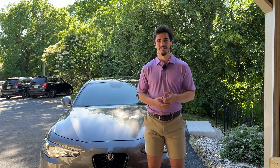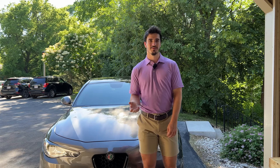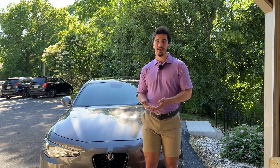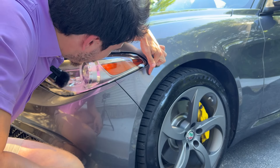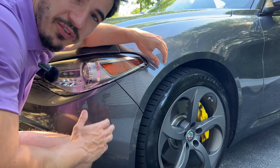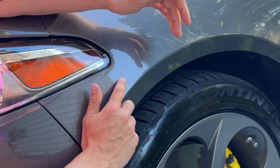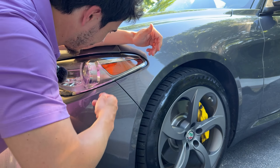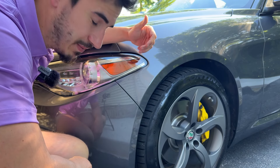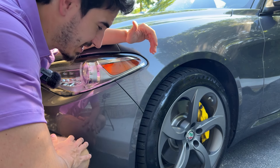I just kind of want to show you how you can polish a little bit of your car and take care of it. I do want to mention that I have a ceramic coat, so if you do something like this and you have any coating, it's going to be removed. You can either reapply it or just not give a damn. If you want to mask off areas you don't want polish to get on, you can, but I'm not going to. This scratch runs basically from my headlight to around here. For dark plastics, get some masking tape.